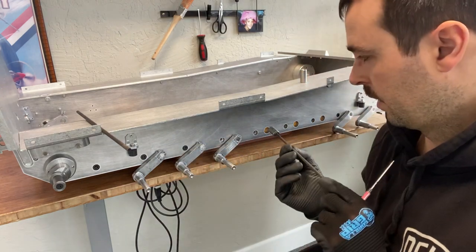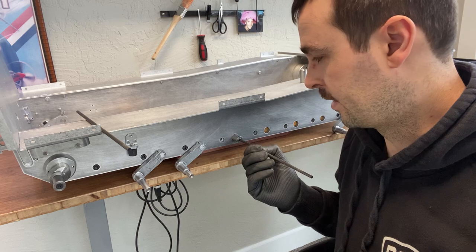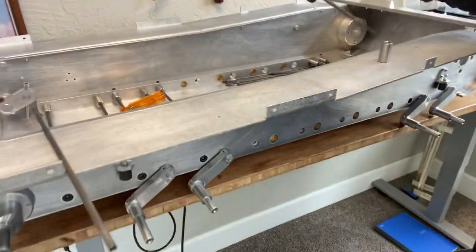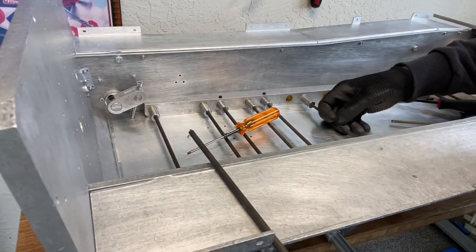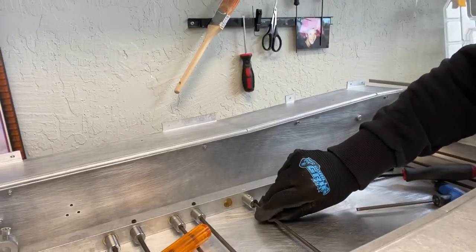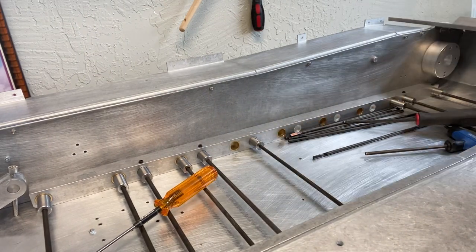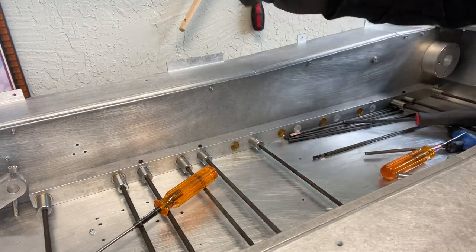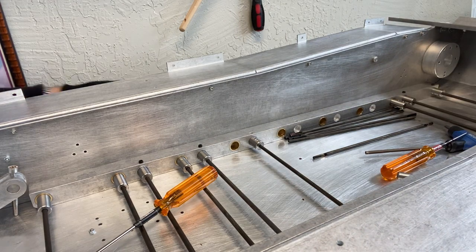This won't slide through the hole, which is why we have to assemble it from the inside and the outside — the fixed end is too thick to fit through that bushing. So I'm going to stick that inside. I'll put it through that hole, and it goes into the suspension bar, into the hole that's halfway there. It's held into place from the outside of the hole by a large 5mm bolt, so I'm going to thread that in from the other side and snug it up.